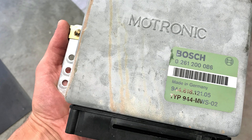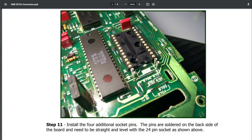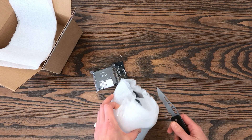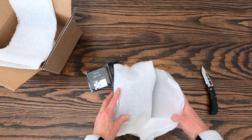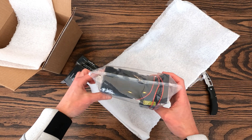While this 28-pin chip is a direct fit for the DMEs found in the 1988 and 1989 model year 944s, the 24-pin DMEs found in years 85.5 through 87 require a conversion to a 28-pin configuration. There are some options and information on Lindsay Racing's website on how to get that done, one of which includes them performing the conversion for you for $50.